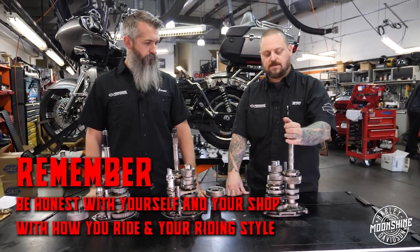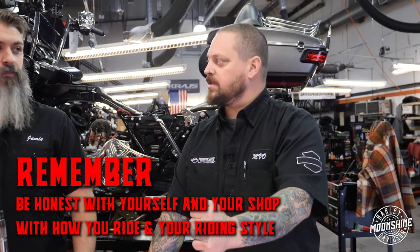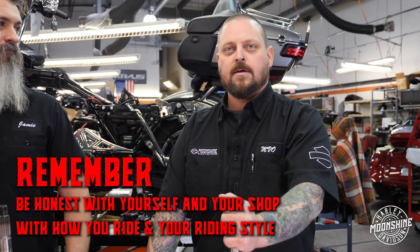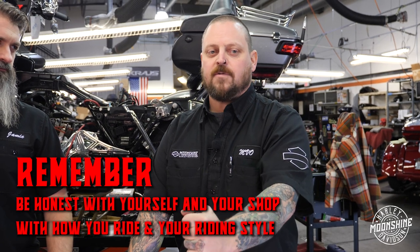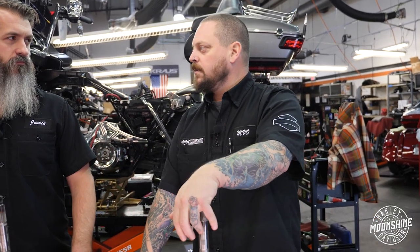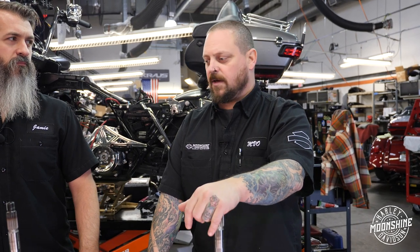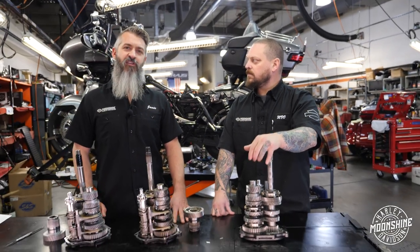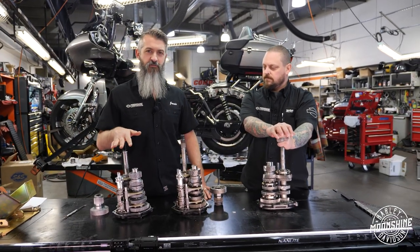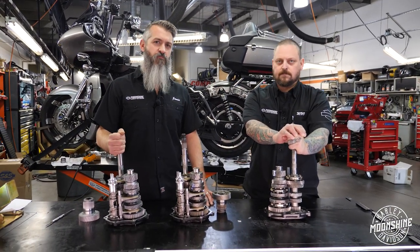When you're getting your motor built, just be honest with the way you ride. If you're lucky enough to go to a shop that asks the qualifying questions — how do you ride, do you ride two-up, do you like to rip light to light — if you tell them you rip light to light all the time, this is probably something you might want to do. If you just want ultimate passing power with a stock-head 124 or 128 that's going to have a lot of torque and you ride two-up occasionally, you probably don't even need it. This is for the guy that occasionally bounces the bike off the rev limiter. If you've never hit the rev limiter, it's probably not something you need. Just twisting the throttle 80–90% — that's not riding hard.